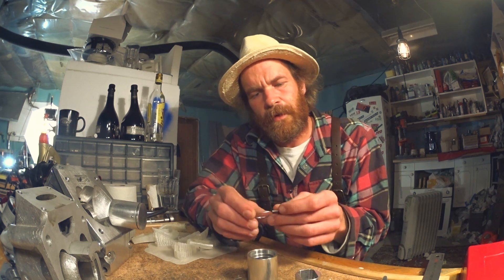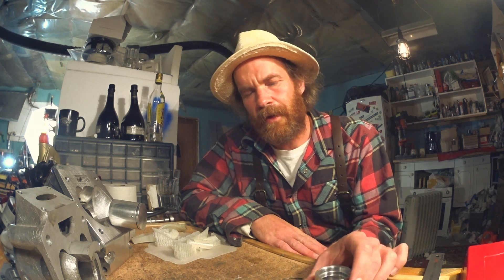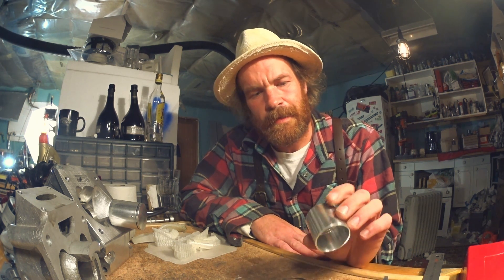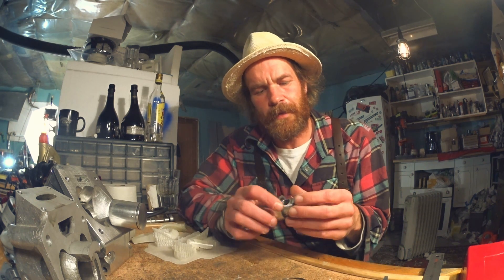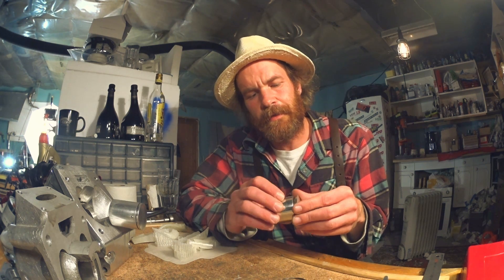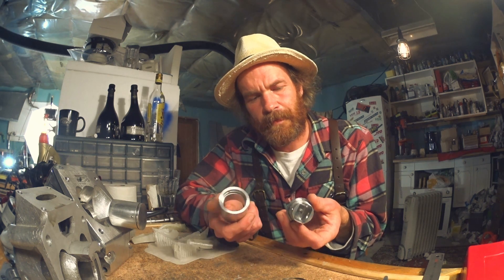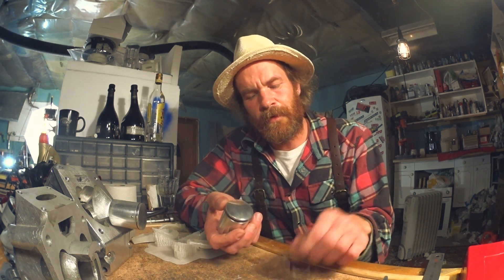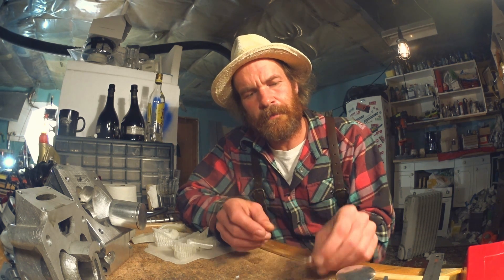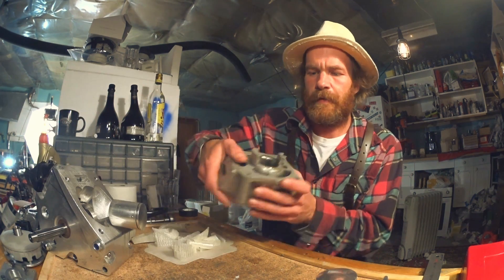We can eliminate the guesswork around whether it's building pressure behind the ring. I've spoken with Mark Atkinson and he's on the case — I could not have done this stuff without him, not without his machine park and his skill in machining and designing. This piston is designed and machined by him, as is the ring, and so will the new piston ring: thinner, harder ring, slightly different design, still retained to be able to run with a 100% of bore exhaust port.